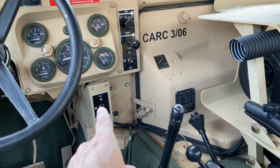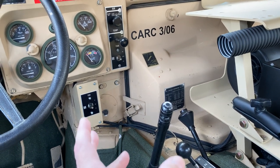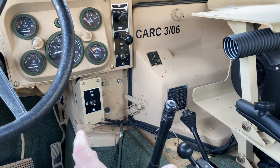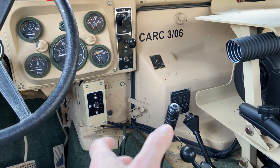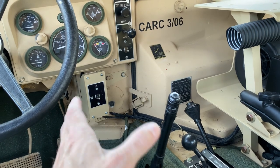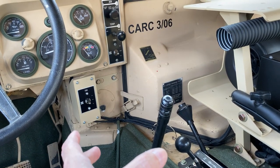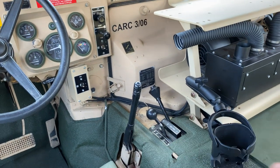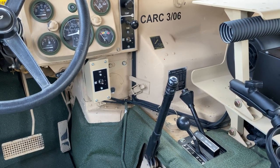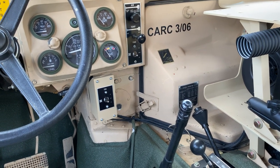Now, wiring this in, for the guys that have these vehicles and are working on them, you probably already have the special pliers for working with the electrical connectors on these vehicles. That's a must have. I don't recommend using brackets or clamps or electrical connectors from, say, Pep Boys or a hardware store. Get the stuff used for these vehicles, because the first problems that a lot of guys run into are grounding issues. Don't try and make your own grounding harness half-ass. There's plenty of information out there on what wire to use, what connectors and stuff. Take the advice of the guys that have been working on these, because if you don't make the grounding harness right, you're just going to still have issues. And I believe there's guys that are even making them and selling them, so you just buy them and put them in.